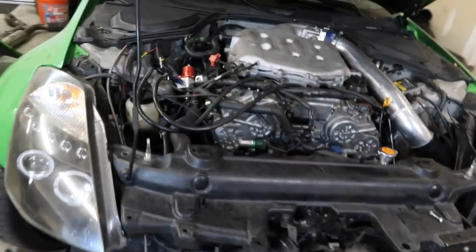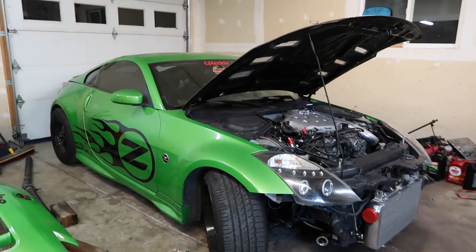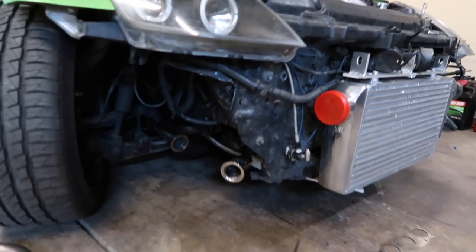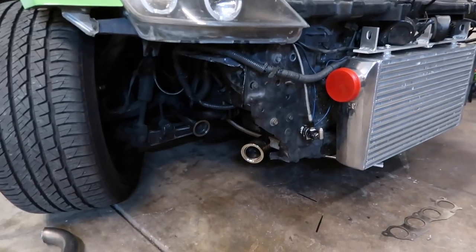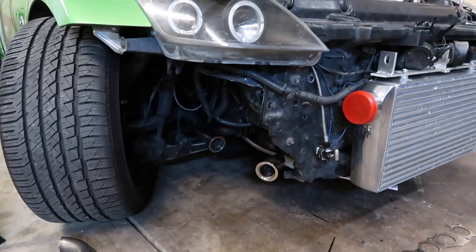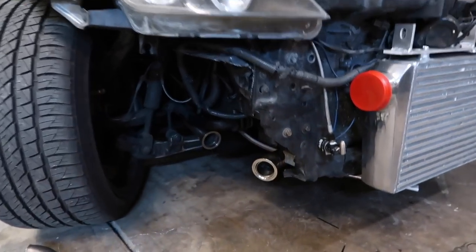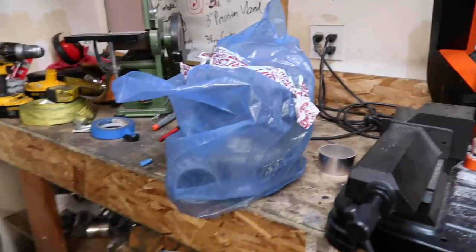Now all I have left, they're gonna come get this, not tomorrow, but the next day. And all I have left to do now is jack it back up, take off those two pipes in there, and clean them out with some brake cleaner. When they cut them, they normally use a bandsaw with coolant, so it's got some coolant residue in it, and the dust from cutting stuff and grinding stuff and sanding it just sticks to it. So I'm gonna make sure everything's clean for him, so nothing runs through his baller ass turbo.